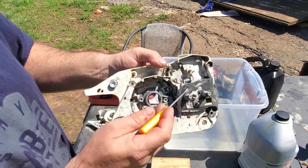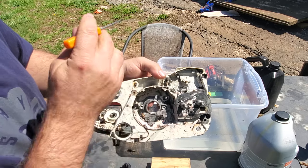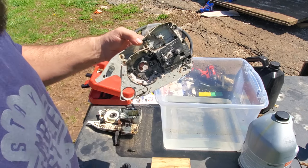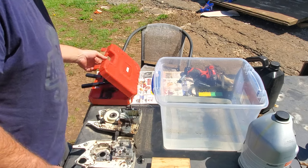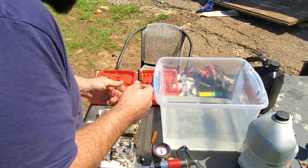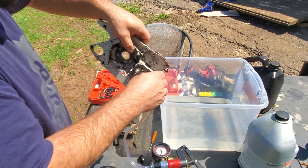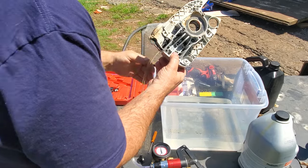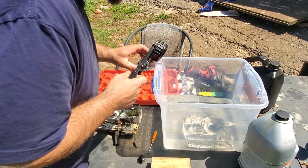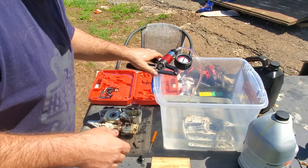That's what's encouraging me right now - the fact that I've got enough redneck skills to figure this out. I can't quit on these chainsaws. I'm going all or nothing - I'm buying a twenty-thousand-dollar building. I can't work in a shed shop and bring you good content unless I do it right, even if I go broke. So basically I took my vacuum pressure tester, found a nice big plug, and we're going to set this right down in the water. She sticks in there because I've got to pump a lot of pressure to this. And there you go - we've already got air bubbles coming out.